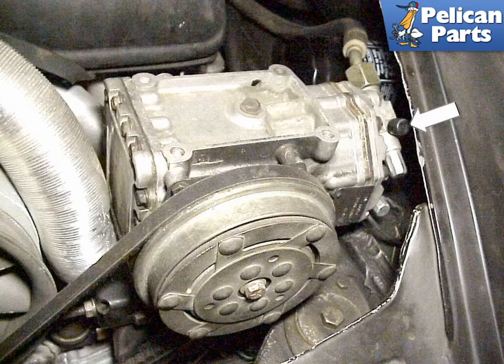This video is to illustrate the main components on the air conditioning system. We are talking about the original system found on the old SCs here that used R12 Freon. The R12 Freon is illegal and can't be sourced anywhere, so if you want to convert your system over to R134 you can do so, but it will lose some effectiveness.